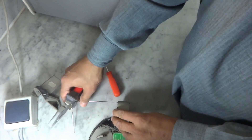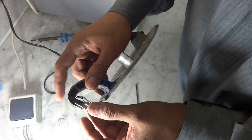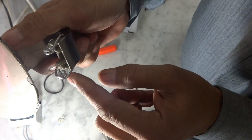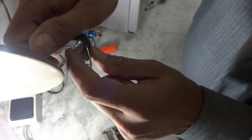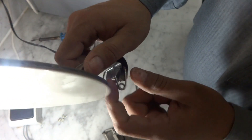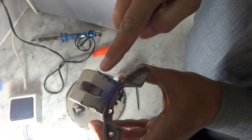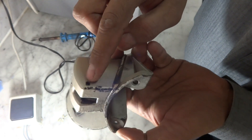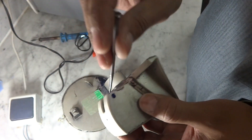Here are the parts for the fuel cap, fuel door. The hinges had been broken, so what I did is I made a through hole over here which is going through here to the other side and coming here — so this is a through hole. What I will do is I will have to pass the wire. This is a regular steel wire. I passed it halfway like this, then I will bend it over here with these two corners and I will make hinges here so that those will be fulcrumed inside.